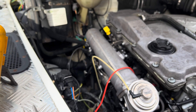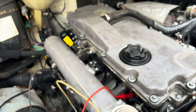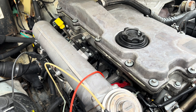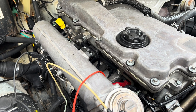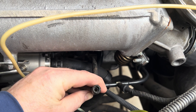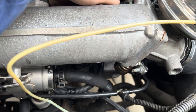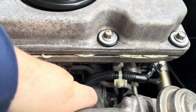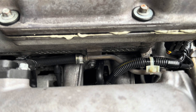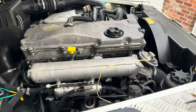No telling how many of these are like that, but if one is burned out, multiple could be. They're just kind of hard to get to for testing, so we'll go ahead and replace them all. I'll plug this lead back on so I don't short it out against anything, fit it underneath there, then go up top with the pliers and get some new glow plugs ordered. Thanks for watching.